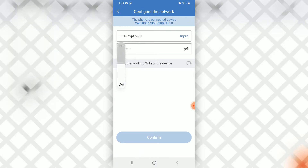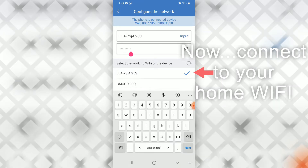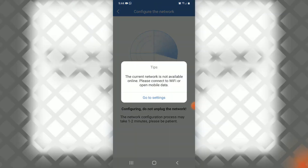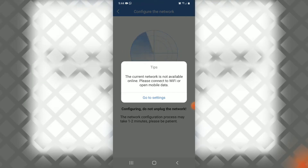We don't want direct connection — we want remote view. When we select 'Remote View' we're going to put in the Wi-Fi password of the modem. I'm adding my Wi-Fi password and then selecting 'Confirm.' Now we're waiting for the camera to connect to the modem — that's the host Wi-Fi. It's successful.